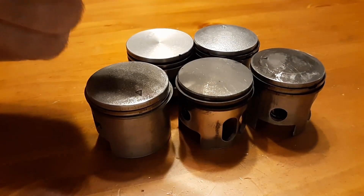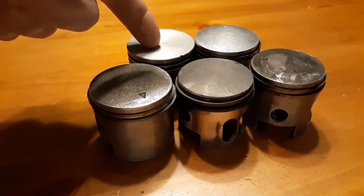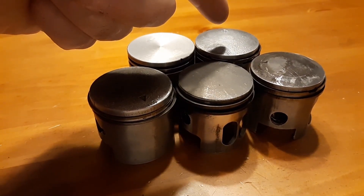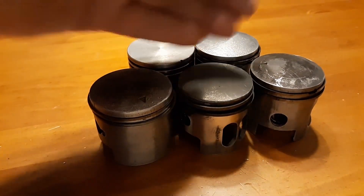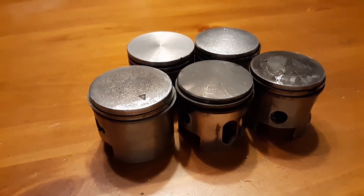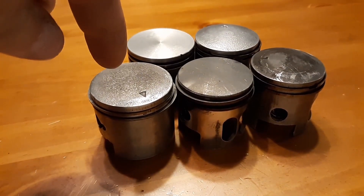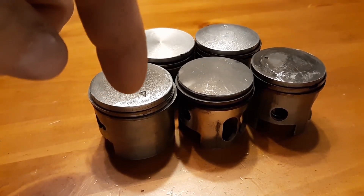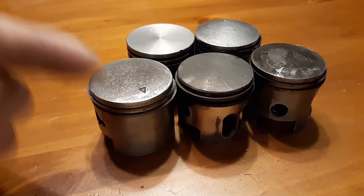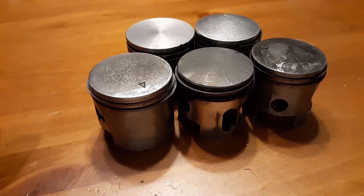I have to put bearings in three or four of them with new crank bearings. This one actually needs a whole new crank bearing assembly — the entire thing in the case — because all the pieces went through and trashed everything. This one was impressive too: when the rod started destroying the crank bearing pin, it jammed into the side of the case and split the case.